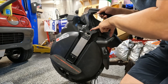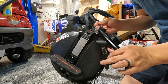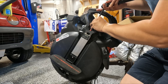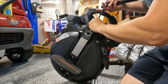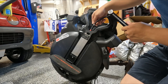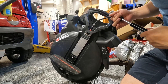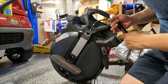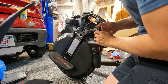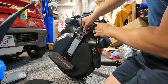Now you have unfettered access to the top valve right here. Take the InMotion pump that they supply, screw this thing in. I've been riding on this probably at zero PSI, just however it came. It's a bit bouncy on the rebound — this should make it a little bit better. I'm going to pump this up to 30 PSI based on some things I've researched online. I guess I'm going to do 60 because it didn't take much to get it up there. So let's just leave it there. I'll try it out.